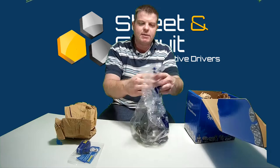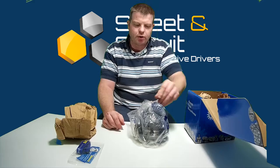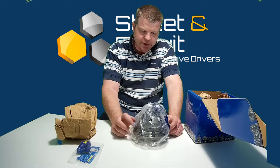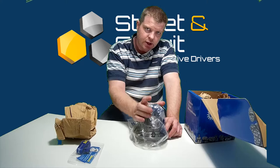It's specifically recommended that you use this differential with the same gear oil the car manufacturer recommends from the factory, and specifically not to use any shockproof-type oils or anything like that. The diffs are simply not designed to work with these supposed shockproof diff oils. You must use the manufacturer-recommended oil — you don't need to put anything special in the diff, and specifically it is recommended that you do not. The shockproof oil does not work with these differentials and can, in fact, damage them.